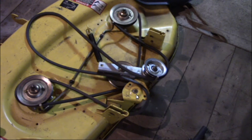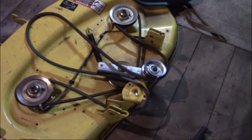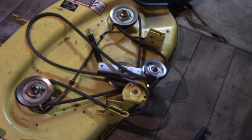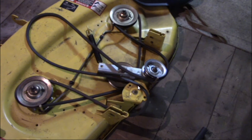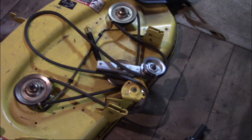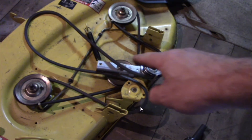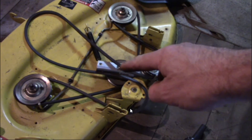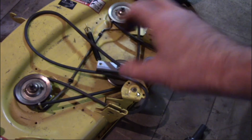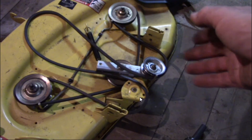The pulley was catching an edge and just snapping the belt clean. Because it's worn into the hole and there's some metal missing, I had to add a washer underneath the pulley to get it back up more in line. I realize these are at angles, but you have to get the pulley back up more in line with this because it's just too low and it's grabbing the belt.